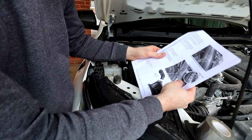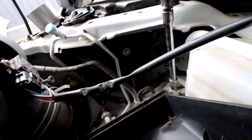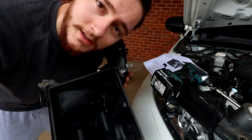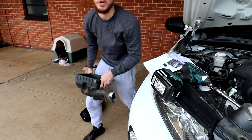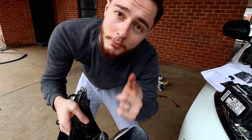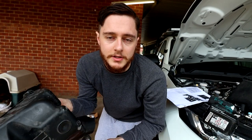We now just need to discard the old air intake duct because it's no longer usable. There's a lot of sand from Coffin Bay National Park in there — when I nearly flooded my car, which is actually the reason I'm installing this snorkel. We're removing and discarding the old intake pipe. Inside the airbox there are little clips that you depress — it sounds so easy but it's not. Oh my god, that was the hardest part of the whole installation — removing those tabs.